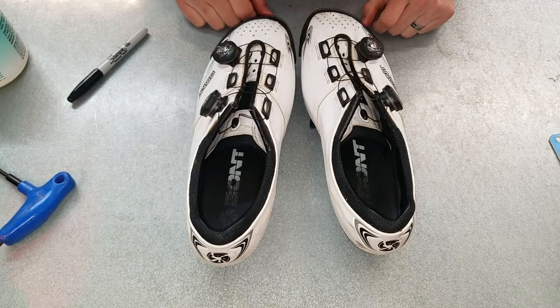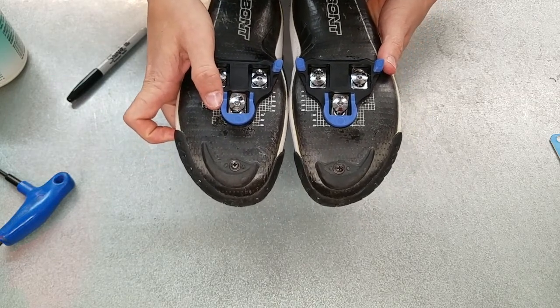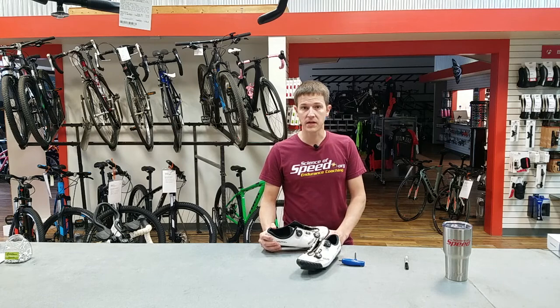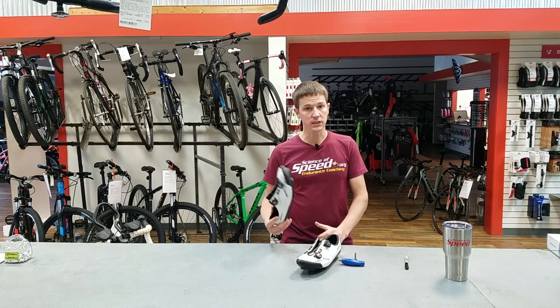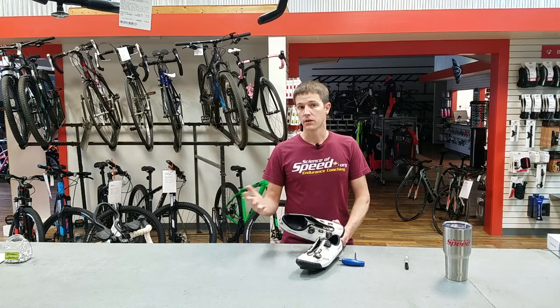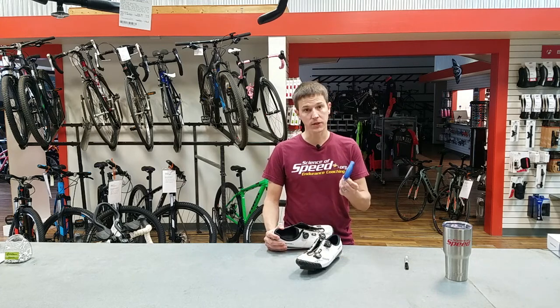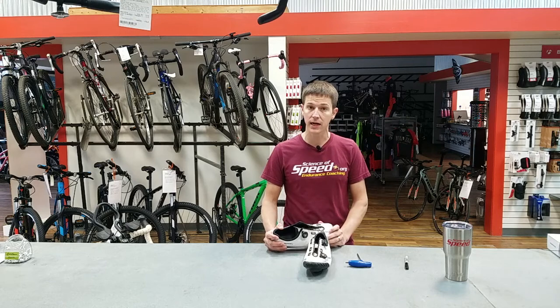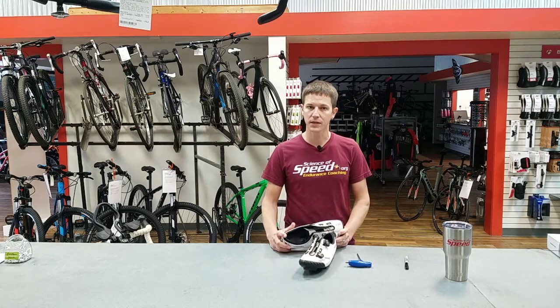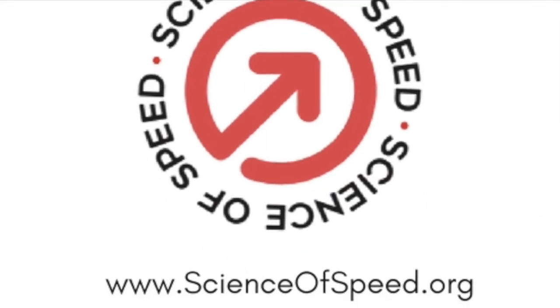After a week or so, I would recommend you go back and just double-check to make sure all these bolts are tight — sometimes they do tend to back off a little bit. As you can see, with about 10 to 15 minutes of your time, you can get your cleats swapped out and your road bike ready for the next ride. Whether you're using Shimano cleats or Look cleats, the method and procedures are the same — your tools might be slightly different, whether you need a slotted screwdriver or maybe a three millimeter Allen key for some Look cleats. Either way, you're ready for your next ride. Thanks for watching, and if you have any questions, please feel free to contact us. We hope you have a wonderful day and a safe next ride.